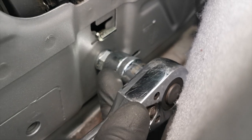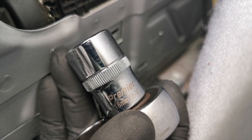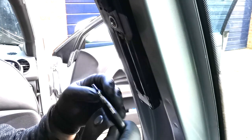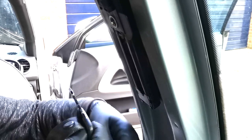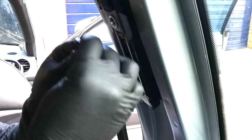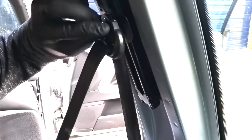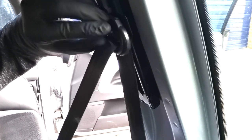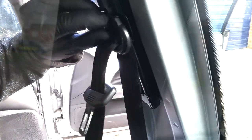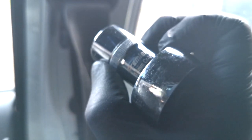You may need to make sure that you do these up quite tight — get your 18mm and put that on there, tighten it right up until you're happy with it. I don't think there's a specific torque measurement for this, but just make sure you do them up nice and tight. Once you've done that, pull the seatbelt up and take it onto the leveling rail — the one that adjusts the seatbelt. That's another 18mm bolt. On this bolt, the way to tell it's the right one is it has no thread at the start of it — if it's got no thread at the start, you know you're on the right track.